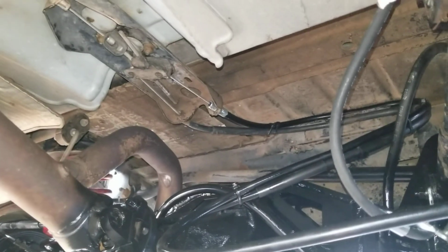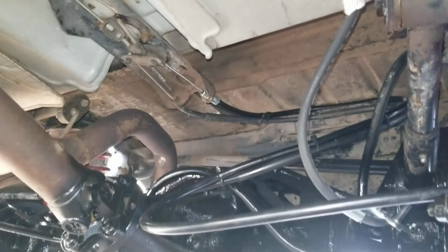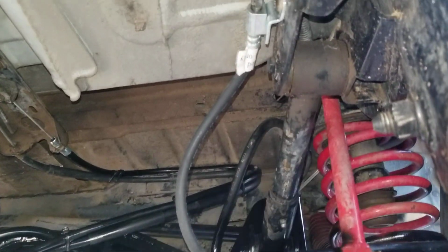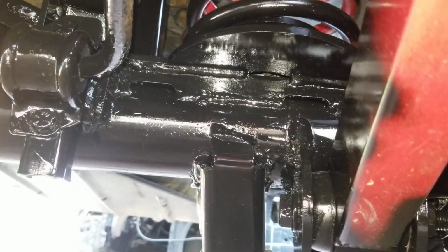So just remember, when you order the brake line e-brake cables, they're not exact length. So maybe you should order 2 instead of 1. Did the extended brake line here to the frame, to the axle. Alright, fully welded tubes to the case. Tubes to case weld. Full truss weld. Turned out pretty good. I'm happy with it.